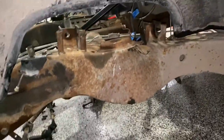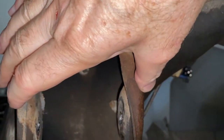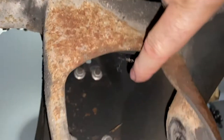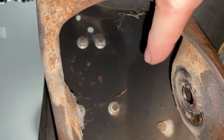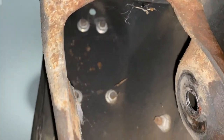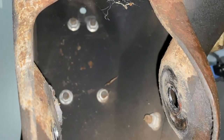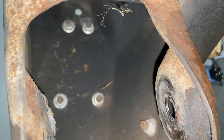We've also cleaned out all the suspension now, so there's nothing left under here - even the brake lines are gone. Now is a great time to change your motor mounts, and here's why: when you go up under here, this is where the lower control arm mounts - the front portion of the A-arm - and you can see the bolts inside there. If you don't remove your control arm you can still do this, but it's not easy, it'll take a lot longer and you're going to use a lot of colorful language. So while we're under here, we're going to go ahead and take these mounts out.